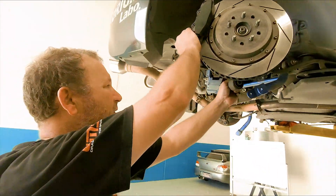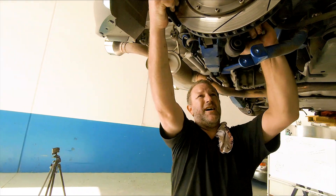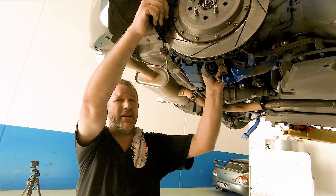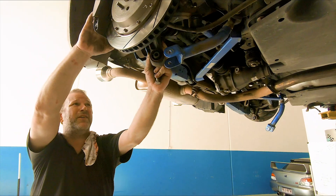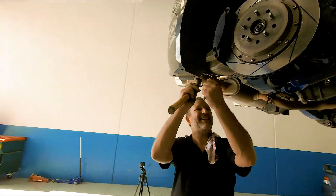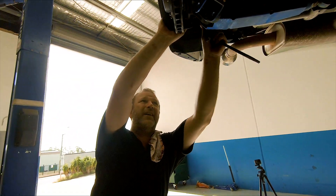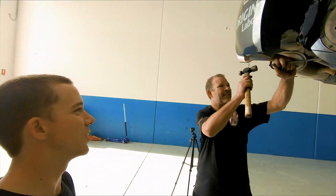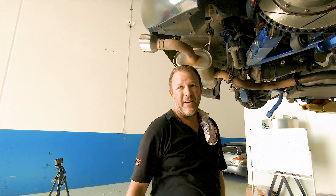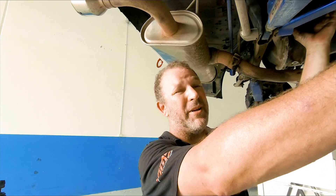A couple of things you had to learn about the 86 through the years. Most of it's pretty good really — they're an awesome little car. It's essentially a Subaru; there's a lot of Subaru Impreza in these cars. The whole rear end setup is almost identical to what the current Impreza is, and obviously the boxer engines are still boxer engines. My opinion is the FA is better than the EJ — I never thought I'd hear anyone say that, especially a Subaru man. Why? The EJ is 30 years old; the FA is the latest technology. The newer stuff is stronger — they engineered a lot of the problems out of the EJ. The FA doesn't have a lot of the same issues. The EJ was never that strong to begin with without going closed deck and all the stuff they're doing now to try and make them more robust.